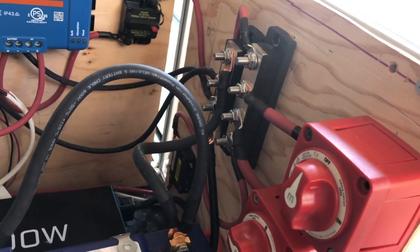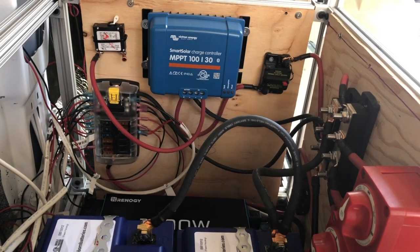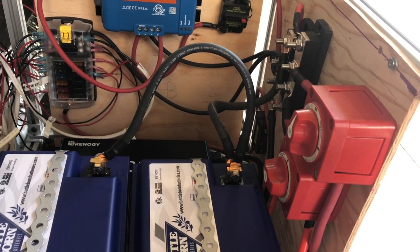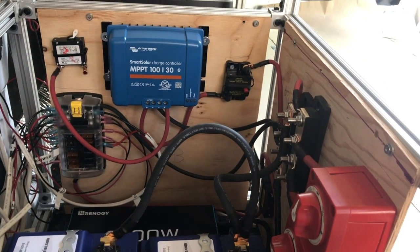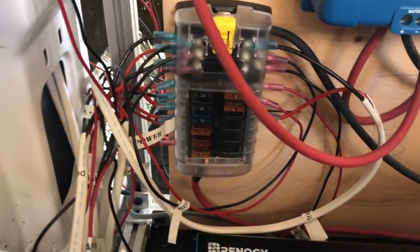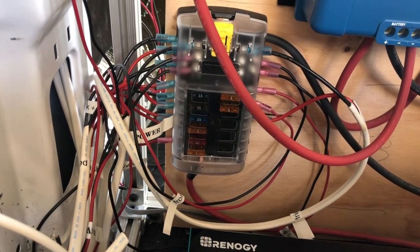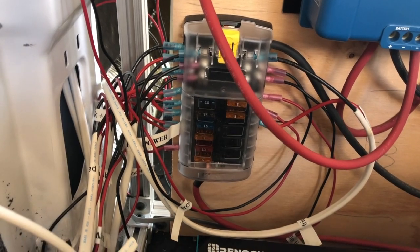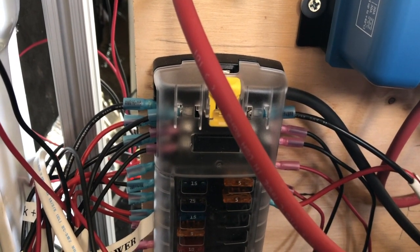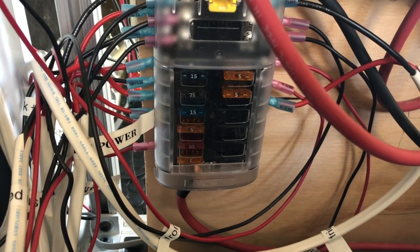It's actually fairly clean and fairly simple — it seems complicated, but it really isn't. I'm going to put up some still pictures and diagrams so you can follow the wiring along, and also put up a PDF diagram you can download and use for your own electrical system. That's the power side of the electrical system. This is my circuit breaker — the fuse box — where all the loads coming in from the lights, the sink, the fan, and the refrigerator get wired with positive at the bottom with the fuse, negative up top. They all have the appropriate size fuses for the wire running to each particular appliance.